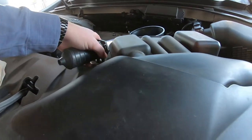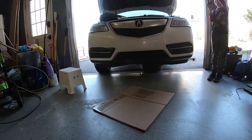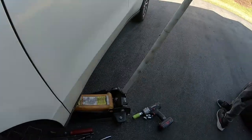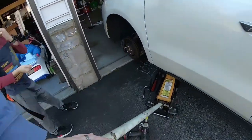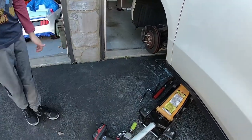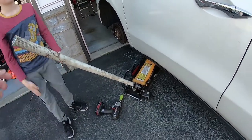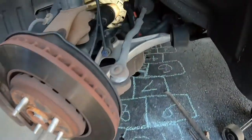Basically what you do is fill it up until it starts leaking out, essentially. Let's see how level we have this vehicle right now — it's actually leaning to that side a little bit. So I'll jack it up one or two pumps. You really need to push down because this takes a good bit of weight. You don't want to sit on it, because if the car starts to roll backwards and you're sitting on this, you're going to get stuck under it — yeah, and hurt.